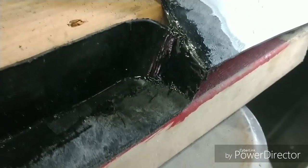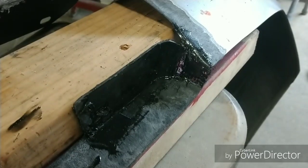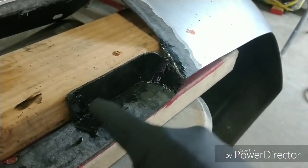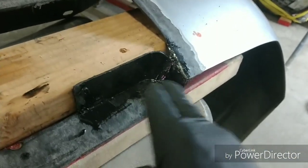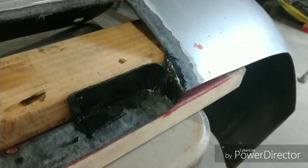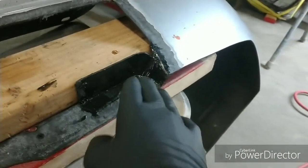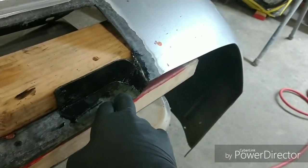You can make plastic. They do make two-part adhesion products for just that. So you can see the radius here that we're going to be going with, and then I can sand this after, and I can bodywork all this, and it's ready to go. But it's not done. This is not finished. Just because this is glued and contoured doesn't mean that this repair is actually finished.